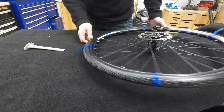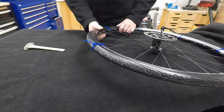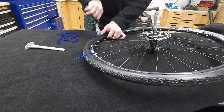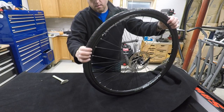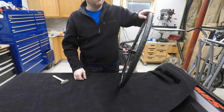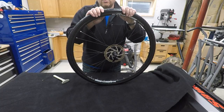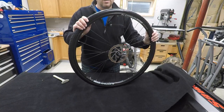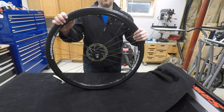It took a little bit of effort. We'll take the zip ties off now, inspect the tire, make sure everything's sitting well, and then we should be able to put it back on the bike. The tire's all on — we've gone around and checked every single one of the pins, everything is in place, and the tire is ready to go. Now I don't have to deal with any more flat tires. One thing to consider is that these have a mold release on them, so for the first 40 to 50 miles they may not feel like a normal tire and may have a little more rolling resistance. Give it some time, allow the mold release to come off, and then it should feel normal. This has less rolling resistance than some of the other solid tires available, so I'm looking forward to seeing how these feel.